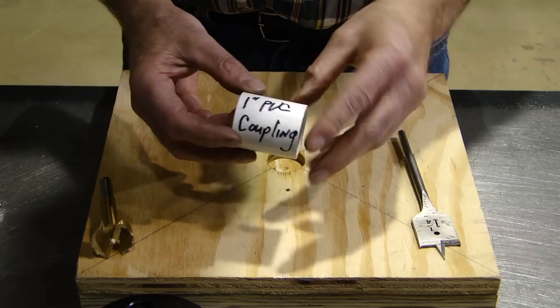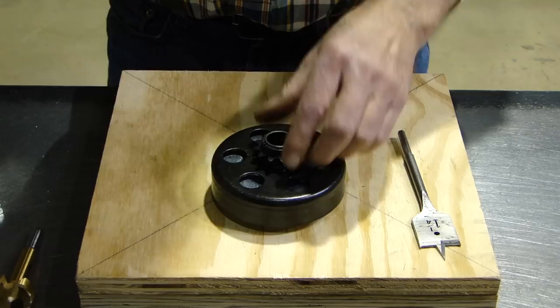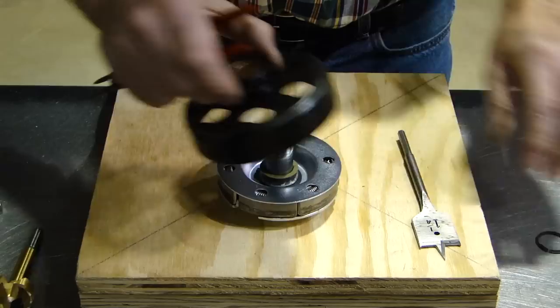It's a simple tool — you'll see how we use this a little later. Taking the clutch apart, we start with the smaller snap ring pliers, remove the outer snap ring, the drum lifts off, and then we remove the sprocket from the drum with the larger snap ring pliers.